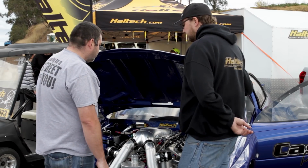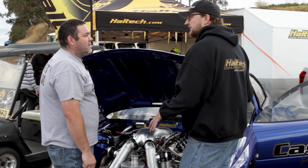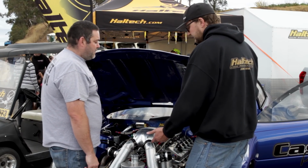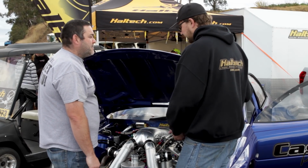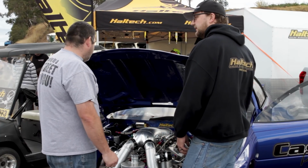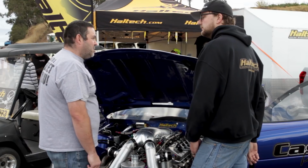And the ECU is determining the dome pressure, not the manifold pressure? Correct. We target dome pressure in the wastegates. So really roughly, say for example you targeted 20 pounds in the dome of the wastegate, what sort of boost pressure would you see? On this motor, probably 22, 23 pounds.